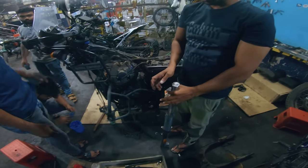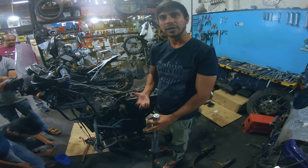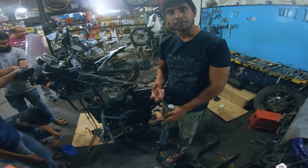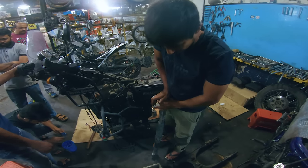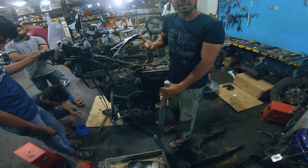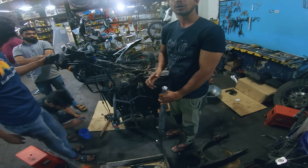Okay, so especially on your suspension, it was with the stock suspension. I have also seen your vlogs, it's more off-roading than road-oriented. So this is a setup in which we add an extra spring, which is more compressed and has more temper. In this, the rebound is better than the stock. So it doesn't get compressed that easily. And even the rebound, see, you get a very smooth movement. It doesn't hit back very directly. Also it doesn't get compressed that easily. So the tension we have created is more than the stock.